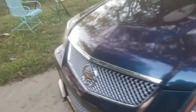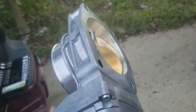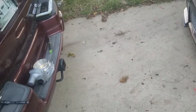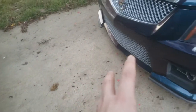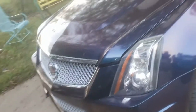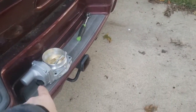It's going to make a nice little increase. I picked up from Weapon X Motorsports a nice LS7 90 millimeter throttle body, but this has also been ported by Weapon X, so it's roughly 95 millimeters. I was going to go with the LSA 87 millimeter stock throttle body, port and polished, however port and polished it only came out to like 92 millimeters versus this which port and polished comes out to 95 millimeters.